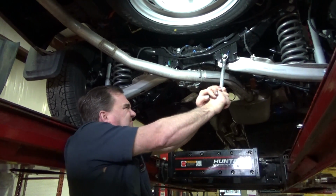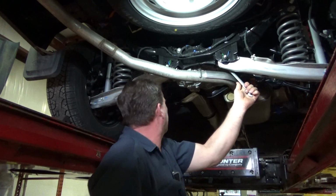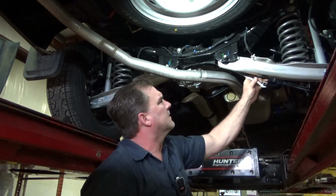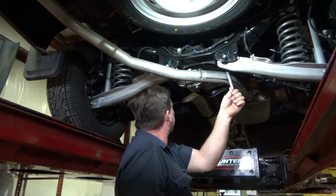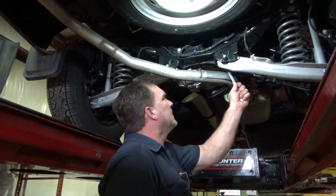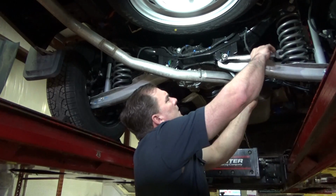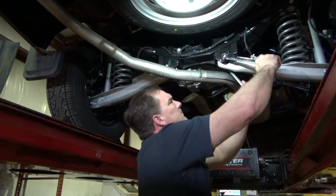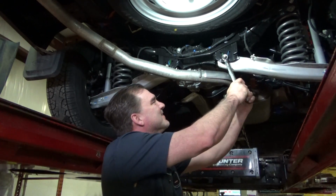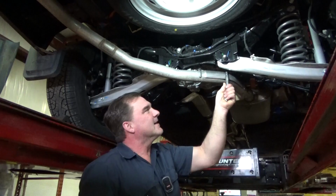Basically 21. Oh, well, that was tight. And then 19, make your adjustment. And we're toed in, we need to toe out. Means I need to bring it in. I can't see that far. So it looks like they want a 10th toe in. I was looking at the wrong reading. I just adjusted the thrust angle instead of the toe because I'm a dummy.